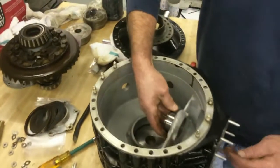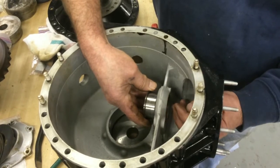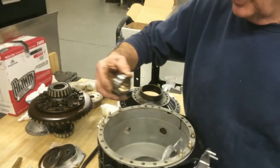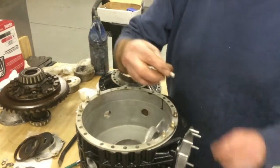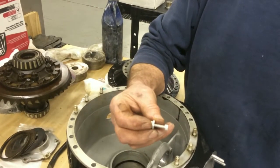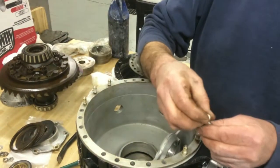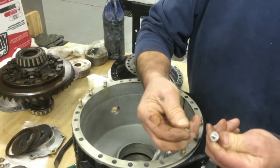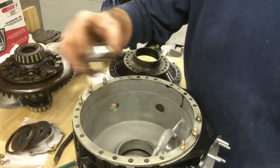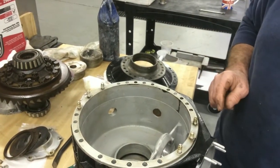So it's necessary to remove the inner bearing for the pinion. This is so that we can take our measurement for the depth of the pinion. It's held in by a couple of Allen-headed screws. They're actually 2BA or 11/32. So you've just removed those. They are pinned over on the end, so it's a little bit of a fight. You're going to need to make sure you can undo them. Move that, and now we will put the side plates back on, and then we can do the setup for the depth of the pinion.